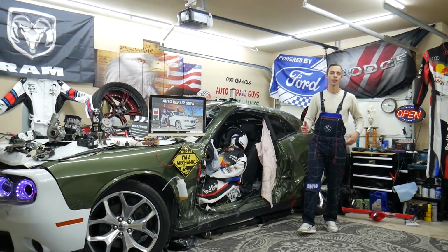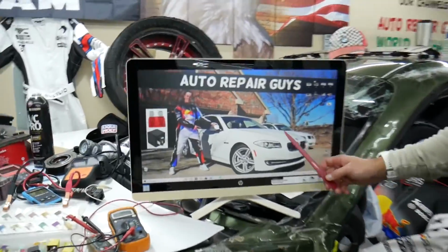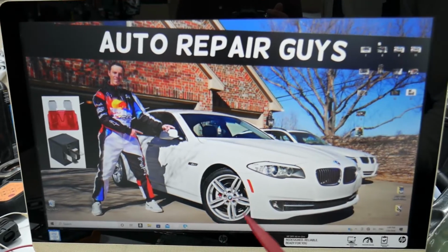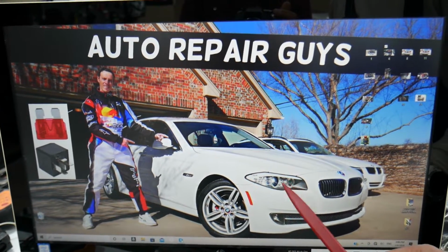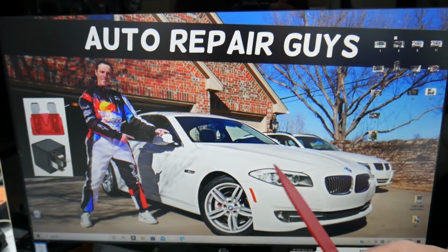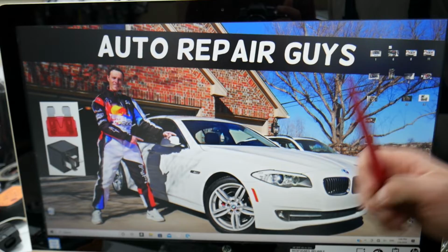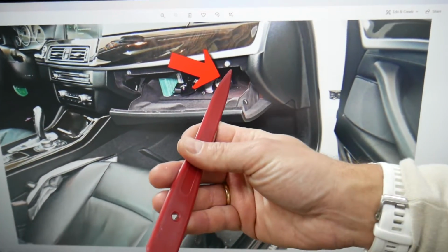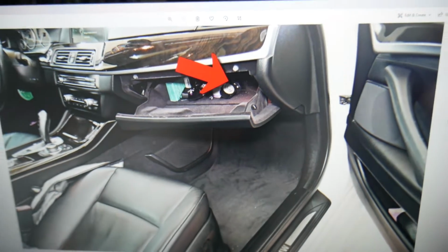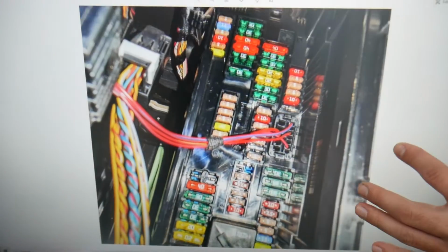So the instrument cluster fuses, up to 5 of them will need to be checked. We will demonstrate on that generation BMW 5 Series here. Guys, we recommend you check out the video on our YouTube channel about fuse box location on BMW F10 F11. We have many hidden fuse boxes that most people don't know exist. Open the passenger door and here, guys, okay, open your glove box. On the very back on the right side there is one cover, remove it and you will find underneath a fuse box with a layout like this one.